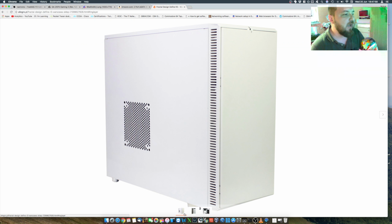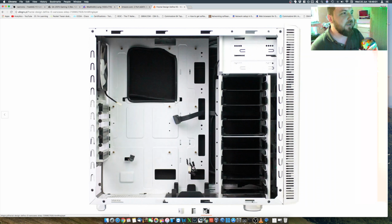And it's designed, built in this beautiful Fractal Design case. Two reasons. One is it's not that big if you consider everything that is installed there. Second, it's very well isolated for noise and dust. You just install two fans in the front, which will give you decent airflow through all of these drives. One exhaust fan, so the pressure is positive. You've got filters before all these fans. That's all good. You've got enough space, and you've got this sound dampening material all around. So even if these drives are a little bit noisier, you are probably good too.